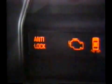Should there be a malfunction in more than one place, the indication of code numbers will start with the smallest code number. When this happens, indication of the second code number will begin after a pause of 2.5 seconds. This warning light blinking pattern will be repeated continuously. After the diagnosed defects have been rectified, the diagnosis memory in the computer must be cleared.